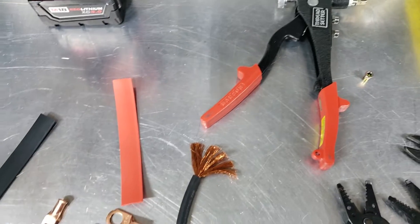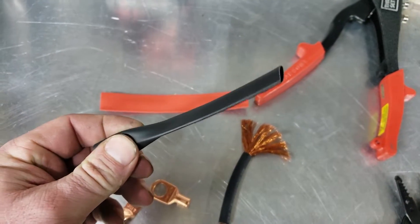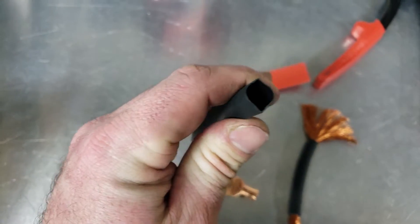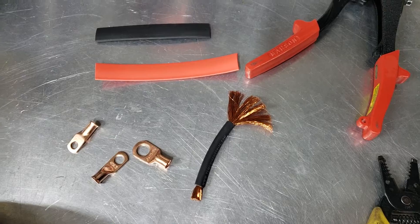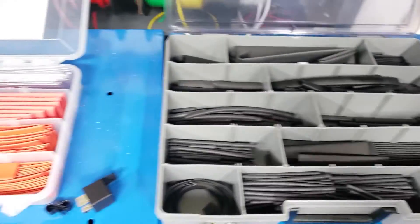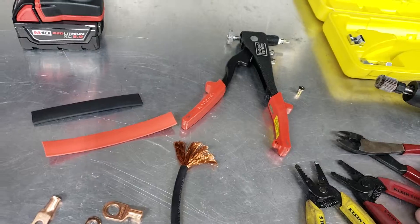Finally, before I show you stuff on the car — good heat shrink. You do not have to buy super high dollar heat shrink; it's nice, but this is three-quarter adhesive lined. Double wall adhesive lined is nice — it creates a nice clean seal between the wire and the connector. Buy some variety packs of heat shrink and make your job a little nicer and a little more robust for holding up to the elements.